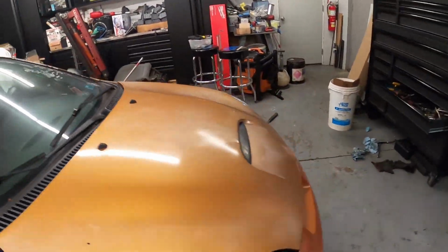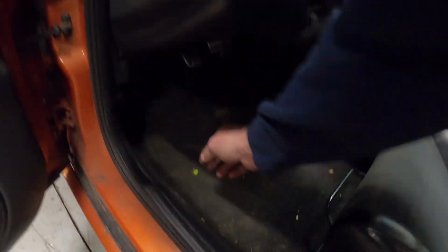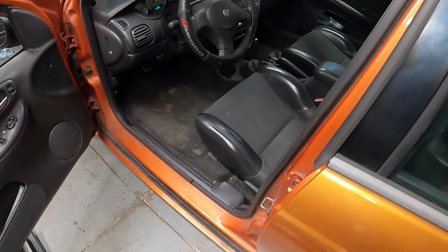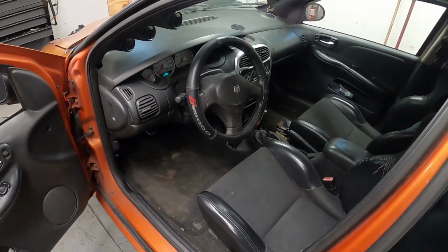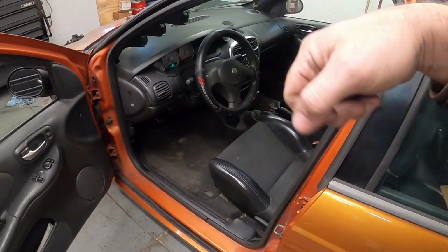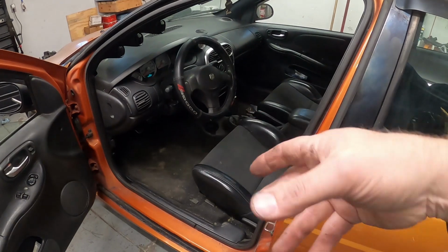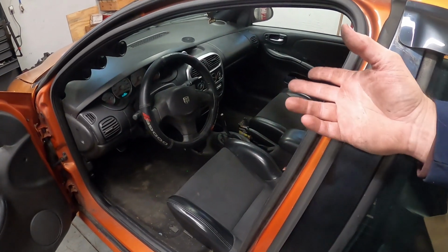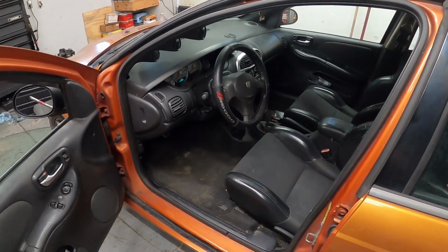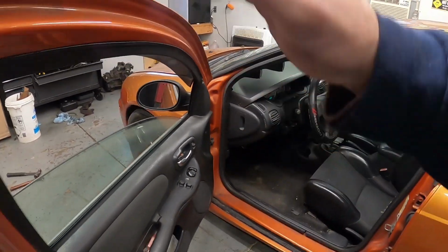Normal Neon locks the doors on you. Like I said, I just came back. I don't have anything dripping on the floor, which is pretty amazing. As I said, this car still needs lots and lots more love. Here's one of the popped fuses. I put one in to try it after I found it originally popped, and it just popped right away. Every time I normally see one of these fuses bad, it's because that blower motor's locked up. So I did reach in to see if it moved when I had the box apart, and it moved a little bit, like you just saw. Sometimes they're locked tight, and I didn't spin it around the entire way, so I figured it was all right. It was the first time I came across that, but it runs, it drives, it blows heat, it stops. Other than pulling to the right a little bit, it's a car with some potential now. When it got here, it did none of the above.